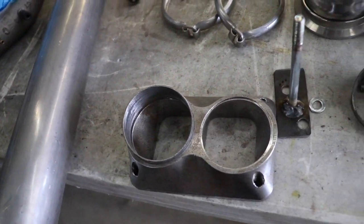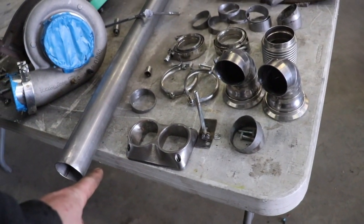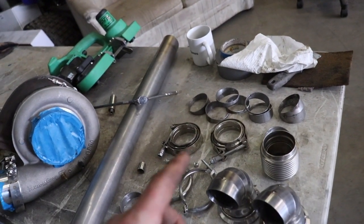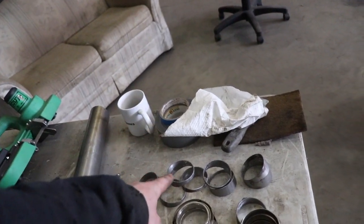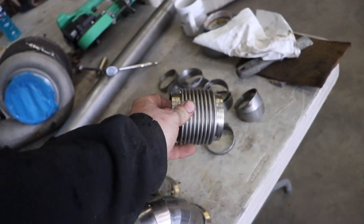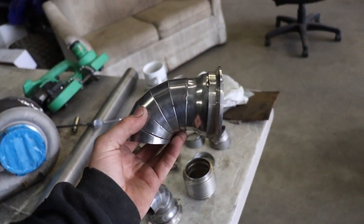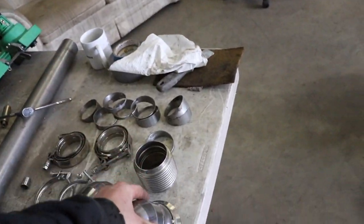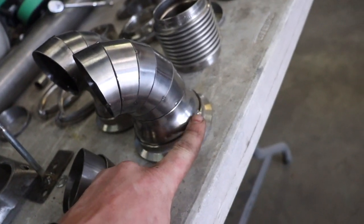The merge collector is recessed, which is going to be nice to work with, and it's drilled and tapped for our flange. We're going to be building everything off of that. I also have some 2.5-inch V-bands to make stuff disconnect, and I already went ahead and cut a straight piece into a bunch of pie cuts so I can make 90s and other angles. I also have a bellow for flex between the two headers. Since the manifold is 3-inch and our tubing is 2.5-inch, I had to use a reducer.